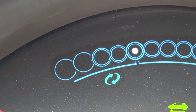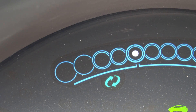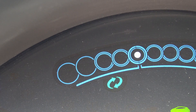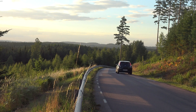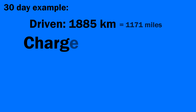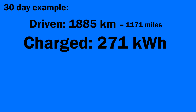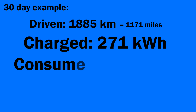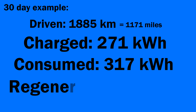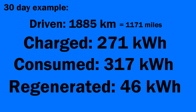But after driving half a kilometer and the battery has been emptied a little bit, suddenly there is some place to store braking energy and you have a little braking effect while driving in the braking mode. As for how much energy the car actually gains: during this month I was driving 1,885 kilometers. To drive this distance I needed to charge 271 kilowatt hours. But the car consumed a full 317 kilowatt hours — meaning I regained from the regenerative braking system a full 46 kilowatt hours. That's quite a lot.